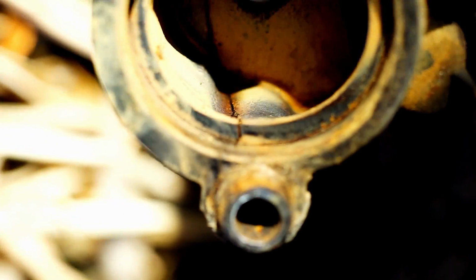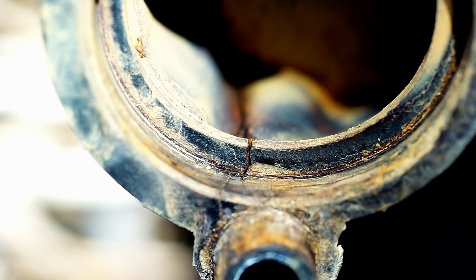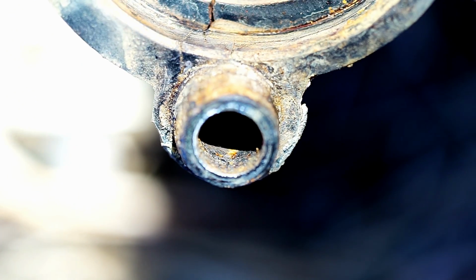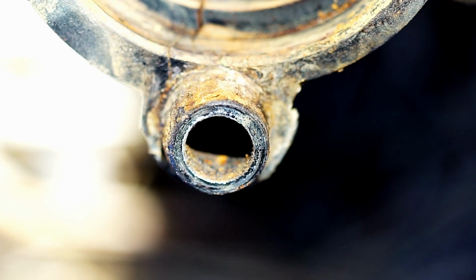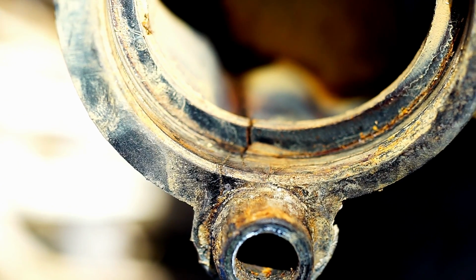This one's all plastic. And you'll see online that people say this cracks. And if you look, there's a crack. There's a crack all up and down there. Maybe I'll take a picture of it. Put that in the video, but you can see the crack there. And I believe why it was leaking, the crack's only on the inside, but I believe the fluid would go through there and probably leak into here where the bolt goes through. So I think that's the deal. In any event, it does not appear to be leaking anymore. So I'm very happy, and it was a ton of work, but I think it solved my leak.